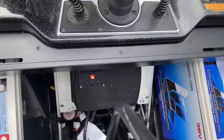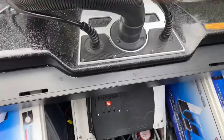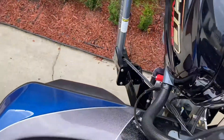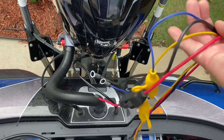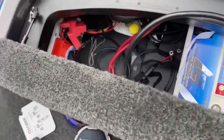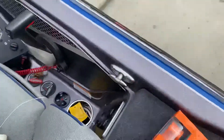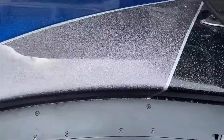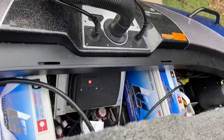The charge system has three main leads. One: big black and red cable — that's for the 12-volt side. Two: the one with all the colors of the rainbow — that's for your 36-volt side. Three: the power cord, which I already have threaded through using that nylon string, running all the way to the front where my plug was. Next we're going to hook everything up based on the cheat sheet.